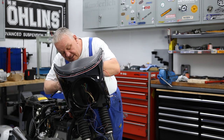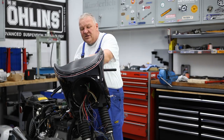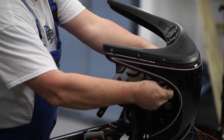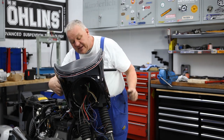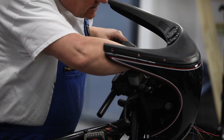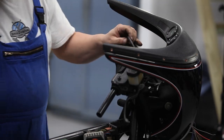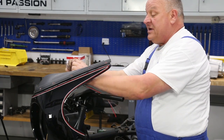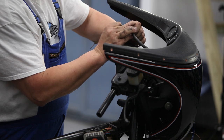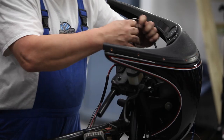The wiring can come up like this and over onto the bracket — I think it would look good — then straight into the hole in the headlight bucket. It's good to have a plan before you actually do anything. I'll throw a zip tie on here to hold it in place for right now. Then I'm going to make just a little slit with a razor blade in the conduit where I want to cut it — just a way to mark it — and then carefully cut that off without damaging the wires.